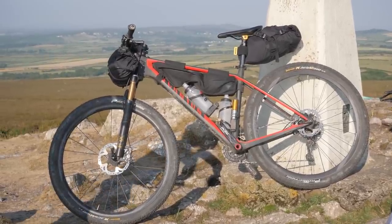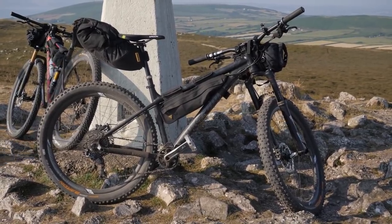When a frame manufacturer is designing a bike, they're not just designing for a high or low shock — they're looking at the overall package. Someone designing a cross-country or bikepacking bike will be looking for space in the front triangle to fit water bottles or bikepacking gear, and will try to have a suspension design that accounts for that. There are loads of different suspension designs and a shock ends up where it is for various reasons. Some manufacturers put the shock where it's all about making the rear end feel as good as possible; others have to sacrifice that to give you space for water bottles. There really is no major significant advantage between horizontal and vertical.